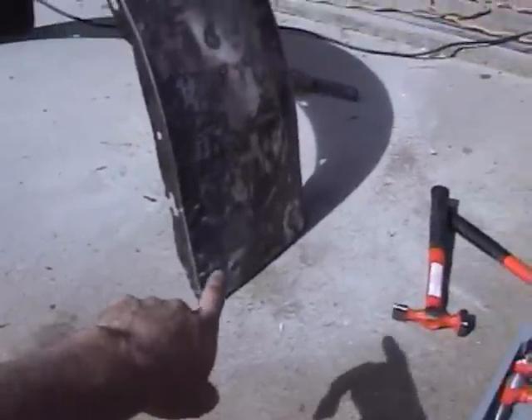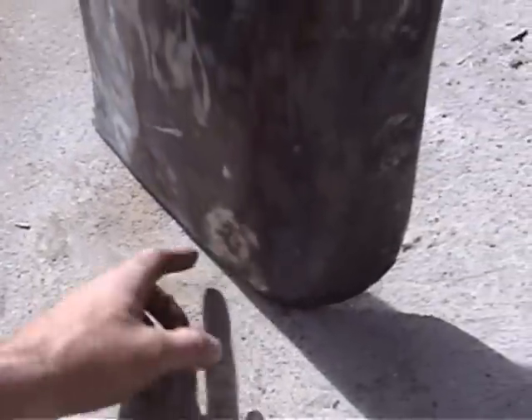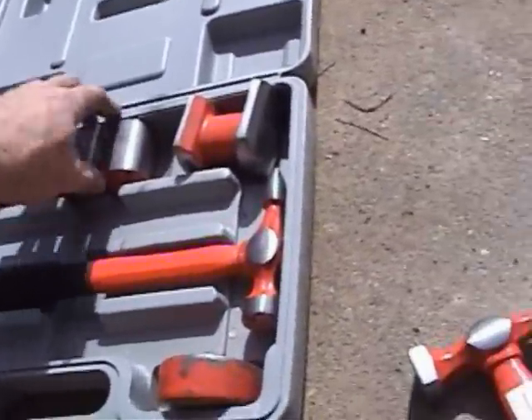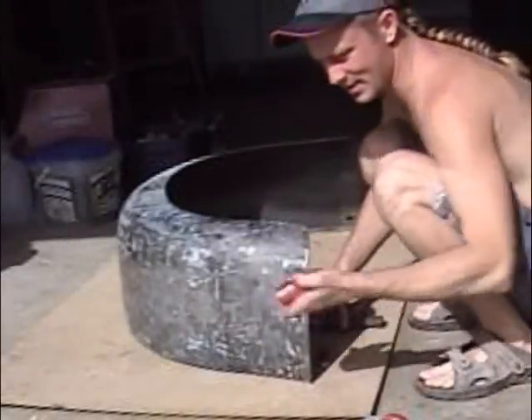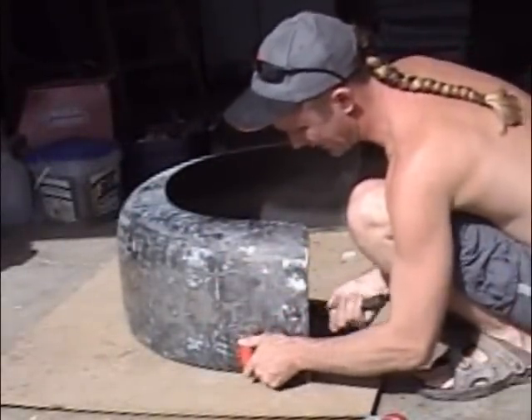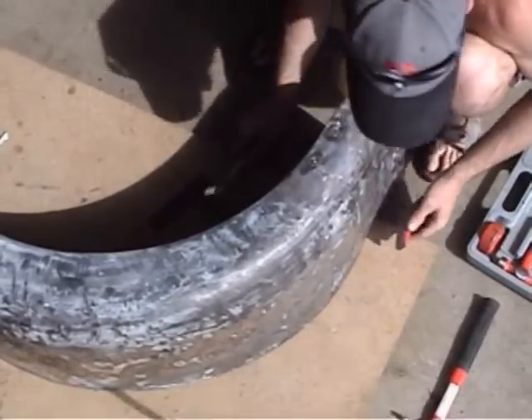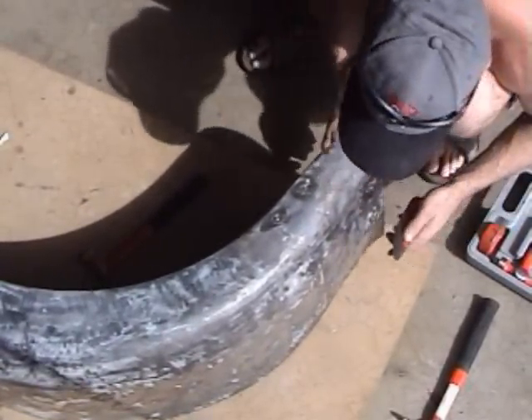What I really want to work on is these dents down here. It's kind of hard to see, but there's one in this general area and then there's a couple down here on the bottom — a big patch in there. There's also a couple big nasty ones right here. These guys did kind of a crappy job with the welding. I'm gonna beat that out using a hammer and dolly set. If you don't have one of these, try to go pick one up. First thing I'm gonna do is take this dolly and this rubber mallet and try to push out some of the bigger dents to rough it out.